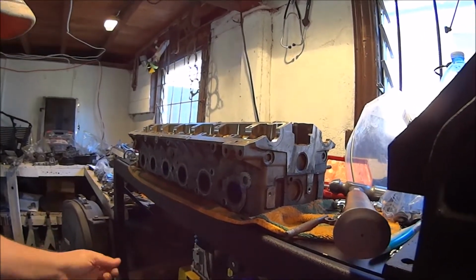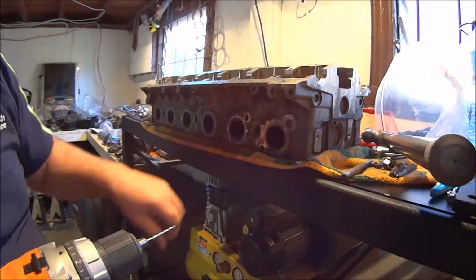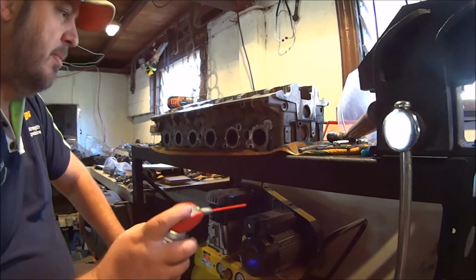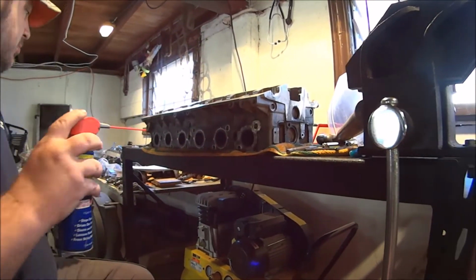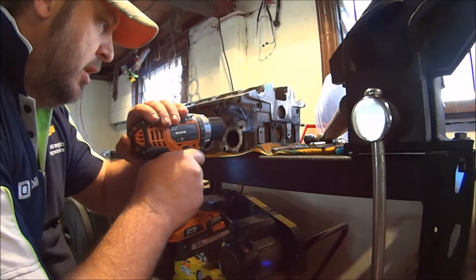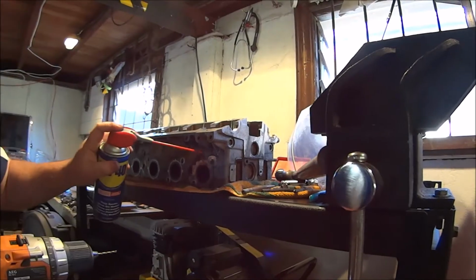Now, don't use a drill bit you like for this, because the studs are so hard, it's probably going to destroy the bit. I've got a whole stack, actually. I'll get the cheap ones out. Can't hurt to get some penetrating fluid in there either, WD, and keep your drill bit cool by spraying it on from time to time. So down to my cheap bits. Let's see how they go. Hardened stud.